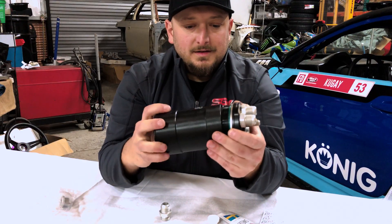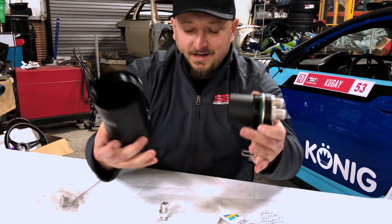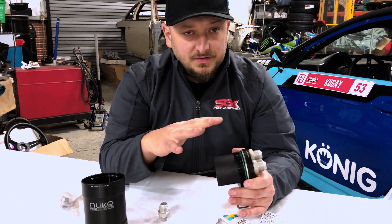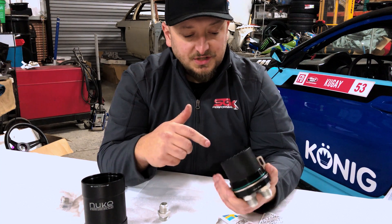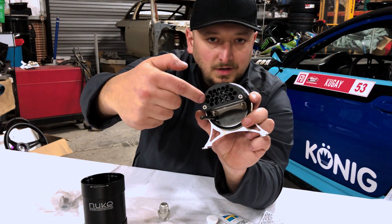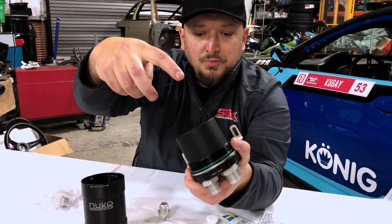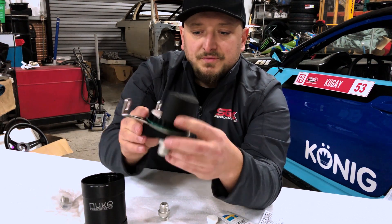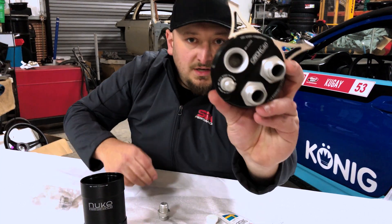The quality of machining is pretty ridiculous — how tight and accurate everything is. The difference between the competition oil catch can and the performance oil catch can is that this has one extra level of filtration. There's steel wool inside, and with two allen keys you can pull those off and clean that section. Then the second filtration comes on the outlet, where there's a baffle and also a screen right on the inside.